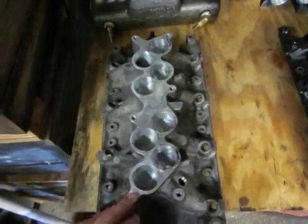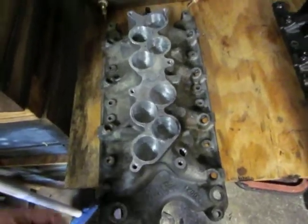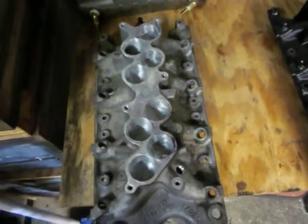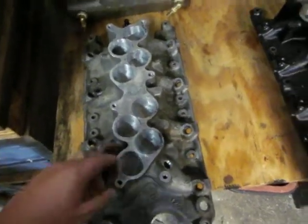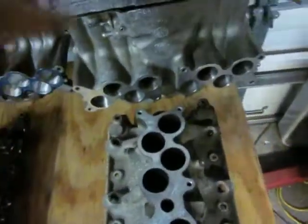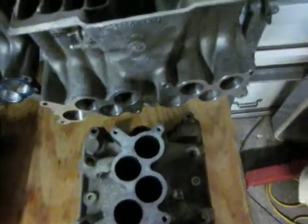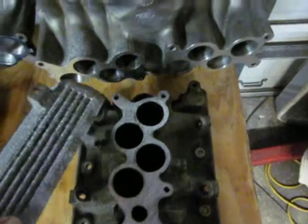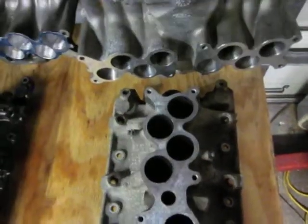This is the latest lower I did. I opened up the inlet to the ports — these ported GT40s I have in the car — to 1.72. So I did the whole port on the lower at 1.72. And then this upper here is going to be 1.72 from where they come into the port and then where it transitions out from the upper to the lower.